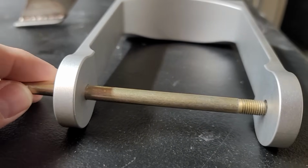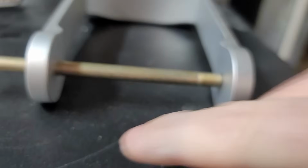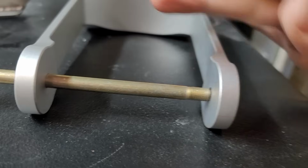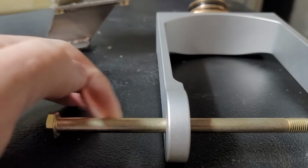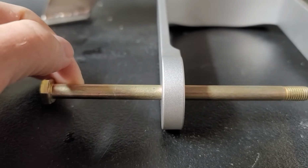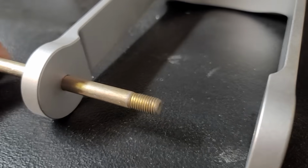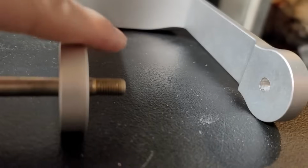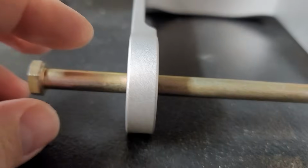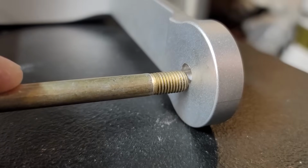So I thought, well, maybe one of these fork faces or these fork ends has gotten twisted. So I measured between here, here, here, you know, several places around here, and it's all identical. So these surfaces are parallel, and then I put the bolt through and then took a scale and measured the angle here, and it's 91.8 degrees, and that's on both sides. So both of these holes have been drilled inaccurately, such that they don't line up properly with one another. As you can see, when you push the bolt through, because this hole is not drilled perpendicular to the fork face, it causes it not to line up at the other side.